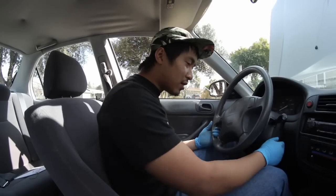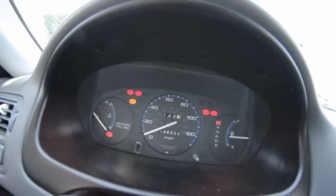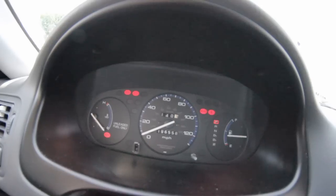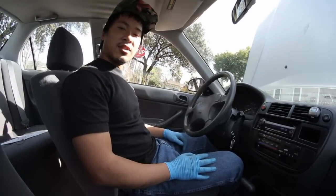So if we look at this one — 10, 20, 30, 40, 41 — it's giving us trouble code 41, which is the primary O2 sensor heater. And that's how you check trouble codes on Hondas without an OBD2 scanner.